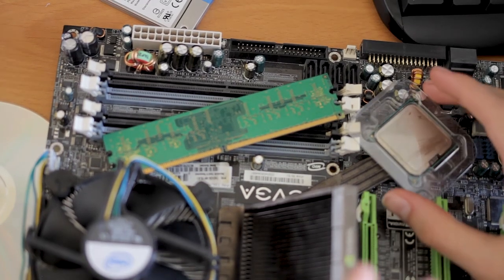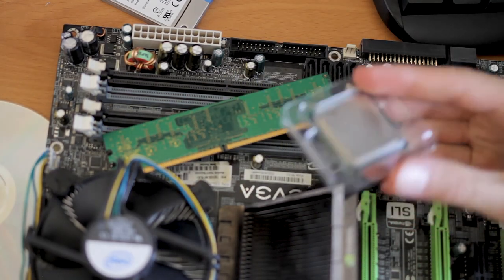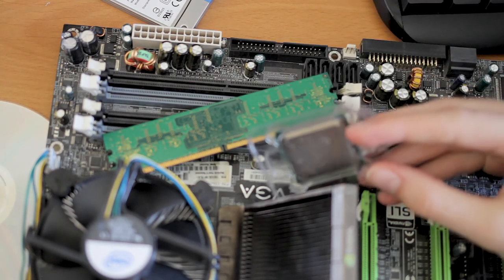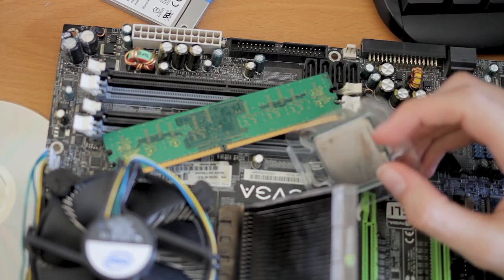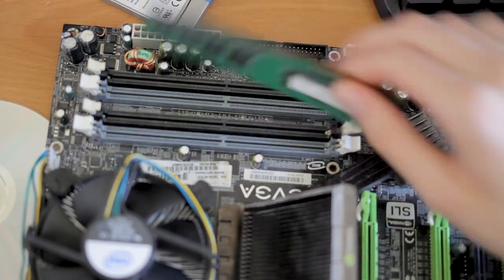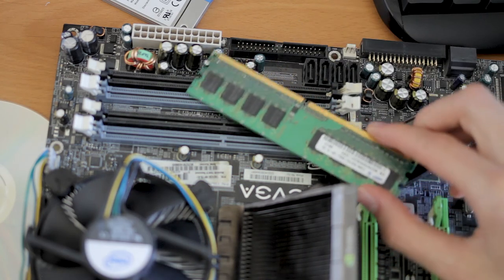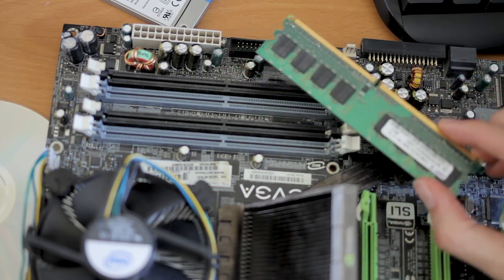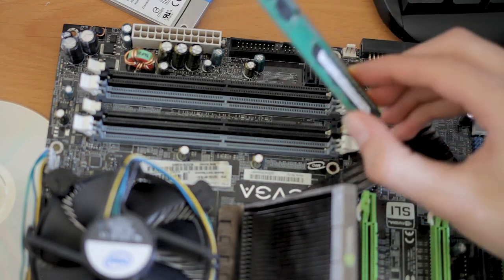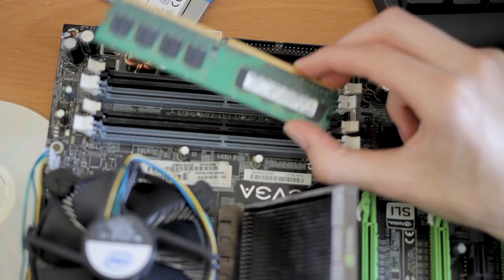For CPU, anything modern works. There's a Core 2 Duo board here — an old Core 2 Duo based Pentium — and they'll work fine. You don't need much CPU. It'll make your sync slightly slower but you're not spending too much time doing that. Memory-wise, plain Debian uses very little — half a gig will be fine. Anything more used as cache will speed it up a little, but no reason to get extra if you're just using it as a file server.